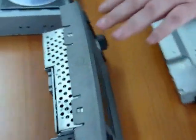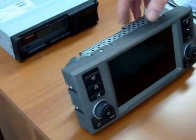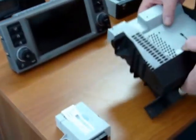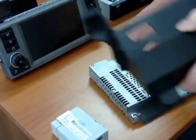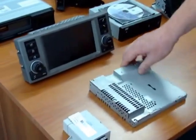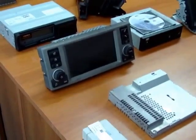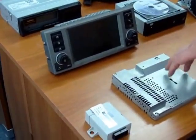It's fitted with this particular screen and of course with a fibre optic loop it connects through to this unit. This is the integrated head unit mounted in a bracket on the bulkhead of the vehicle, and this makes the gateway between the infotainment circuit and the rest of the vehicle's electronics.